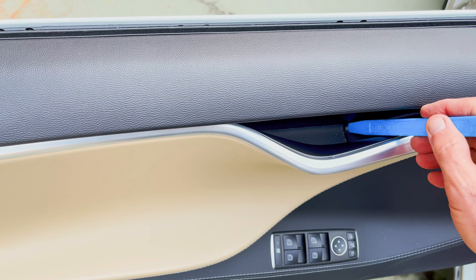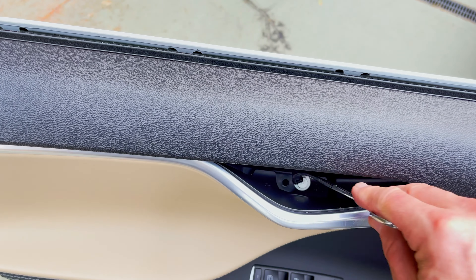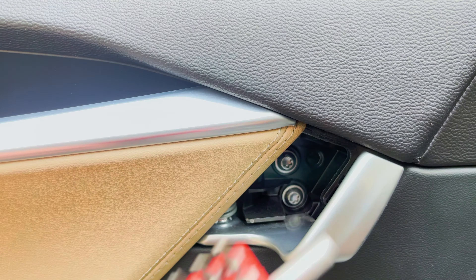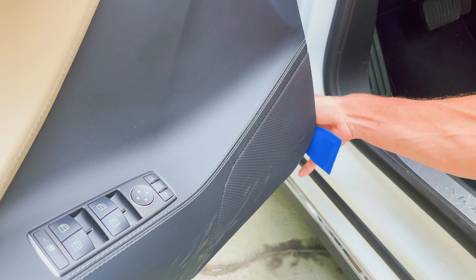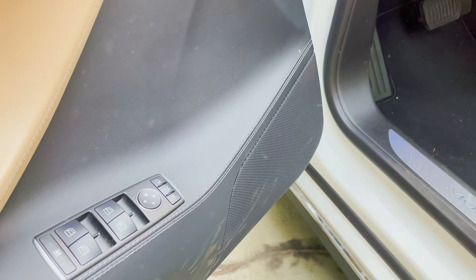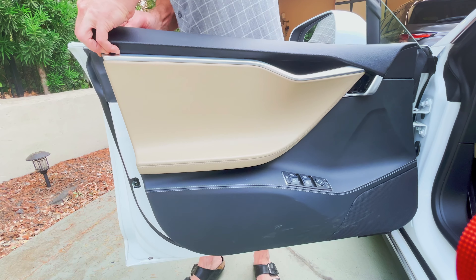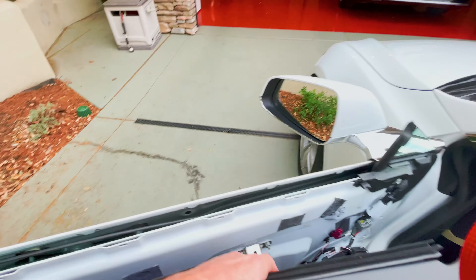This is probably the most tricky part of the repair. Once this is done you need to raise the window glass fully before removing the door trim inside and before disconnecting the power to the window motor. Tesla door trim is relatively easy to remove using plastic automotive trim removal tools, a socket wrench, and a screwdriver with a set of star bits. By carefully prying and pulling I was able to remove the door trim without breaking any mounting clips. Once the bottom and sides of the door trim are free, pull the trim up to remove the rubber gasket from the top of the window well.